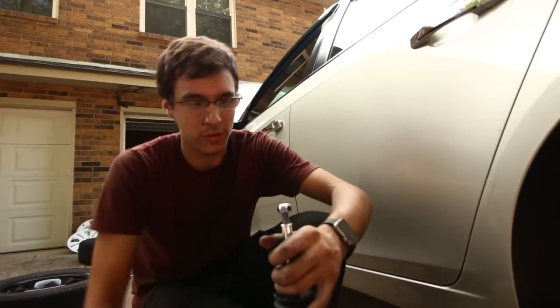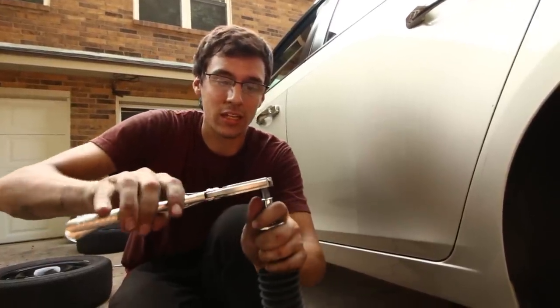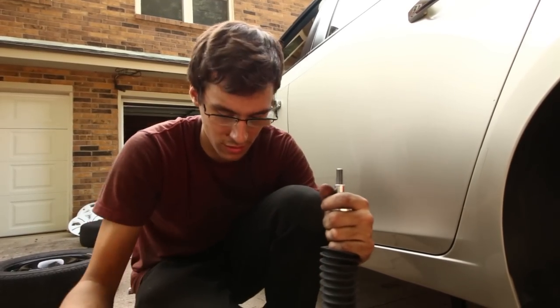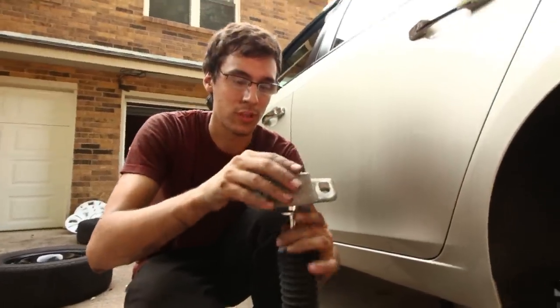But anyways, you might as well just turn them all the way stiff in the beginning. I don't want that to scare you, but you don't really need it. It's not that important. So you might as well just turn them all the way stiff, because that way you can't go wrong. It's better to be full stiff instead of too soft, because if you bottom out your car completely and the suspension just goes all the way up, it's going to do more damage than if you just put it full stiff and run it like that until you get to the point where you want to make an adjustment.